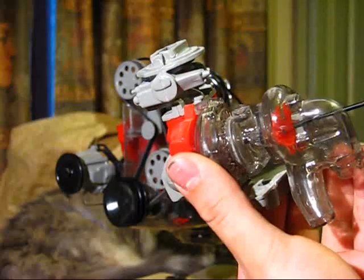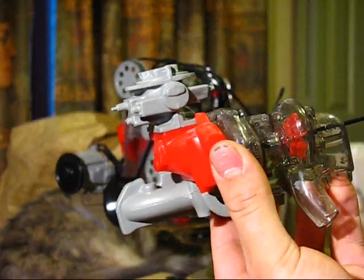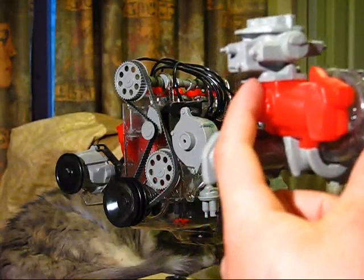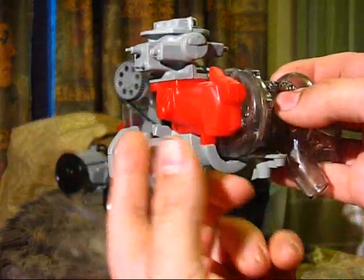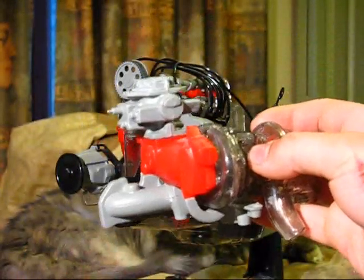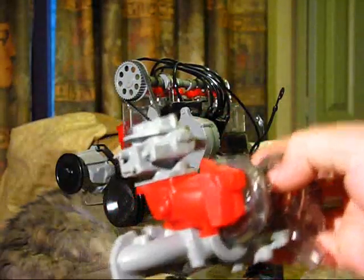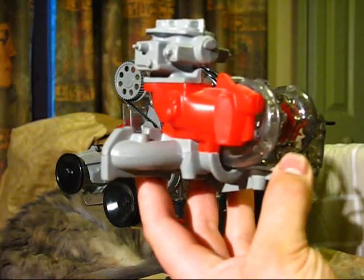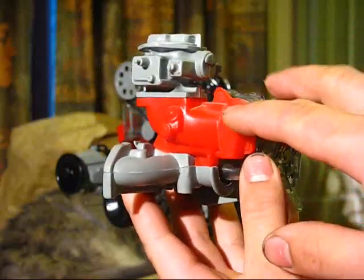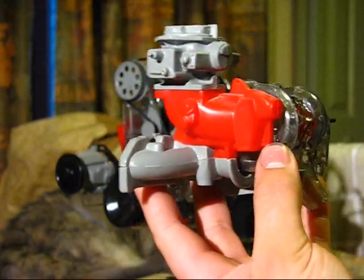This is probably one of the most uncommon setups for high boost and horsepower applications because you can't use a fuel and air mixture running through an intercooler - that would be pretty unsafe as you'd have a combustible mixture in your whole intercooler and piping which could possibly explode. On top of that, you can't even run a blow-off valve because it would be releasing a mixture of fuel and air from the blow-off valve. I'll get into blow-off valves after.